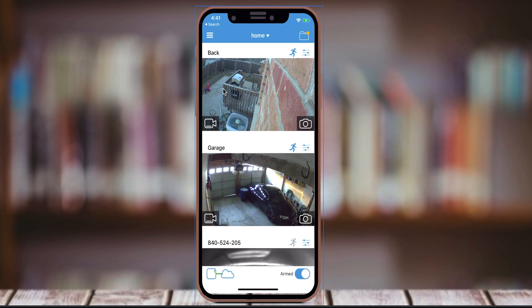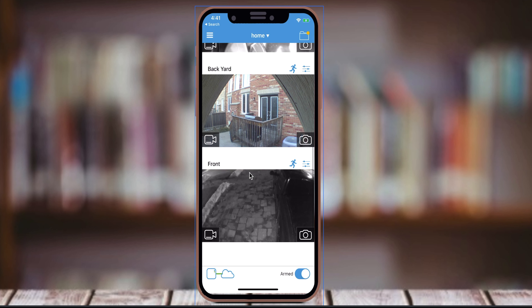I did make another video you can look at, but you have to make sure you have enough wireless access points to cover the outdoor areas, because these cameras are used mostly outdoors. I wouldn't recommend using one indoors in case someone hacks your network. You want your wireless router or access points close enough to the camera locations. Glass is transparent to wireless RF signal, so having my access point in my front window helps carry the signal to where my camera is positioned. Let's go to a live view.